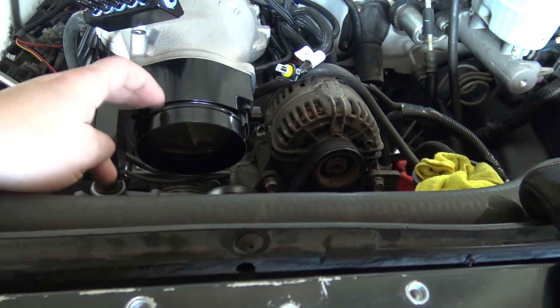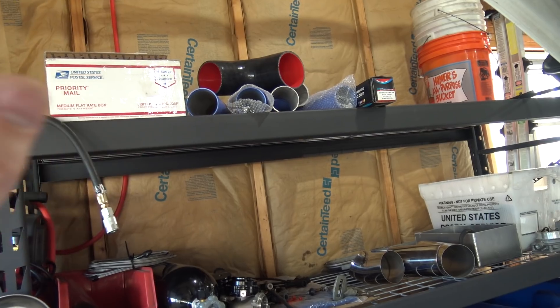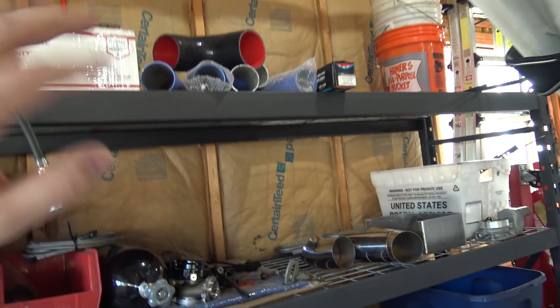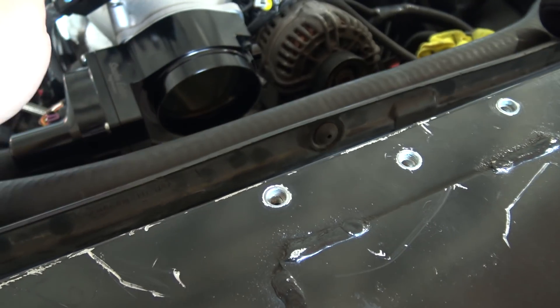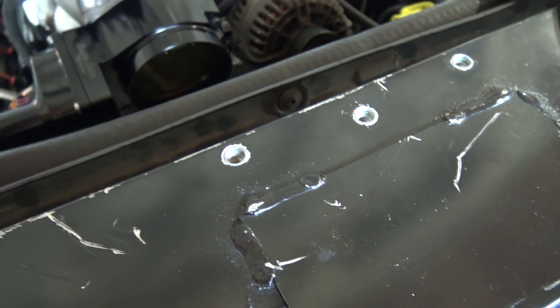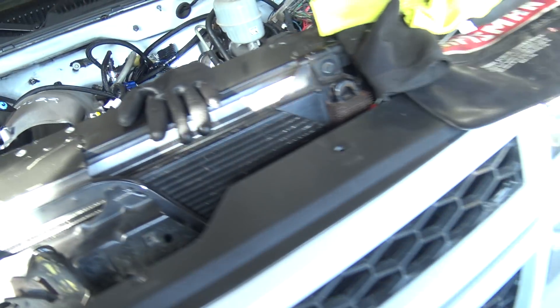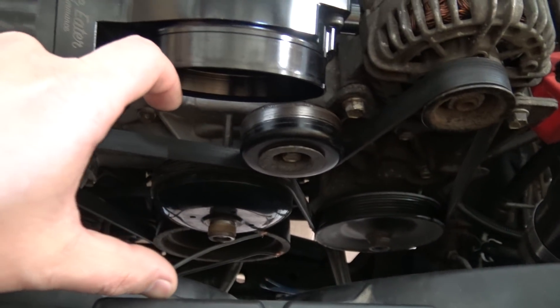People say you can stretch a 4-inch coupler to get it on the 102mm, but I was not successful. I tried boiling water and the microwave — I'll try heating it really well with a space heater to see if I can get it on. I need to get the up-pipe sorted before then too — if I smash it on and can't move it, that's not helpful. Unfortunately the fans and Duramax rad come out farther than I expected, but still much less than the clutch fan.